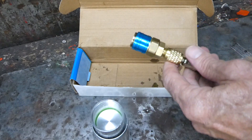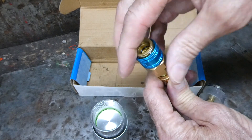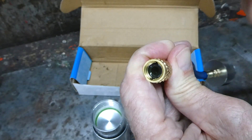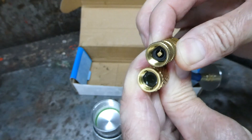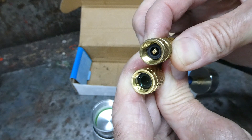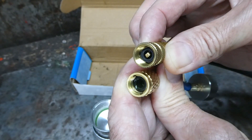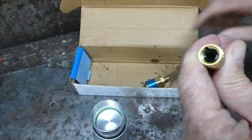On the description of this unit they said it will do R-12, but that fitting doesn't look like R-12 to me. This other one looks similar to what an R-12 fitting would be — so that's something you have to be aware of if you want to do R-12. But in our case we're doing R-134A, so there is no problem there.